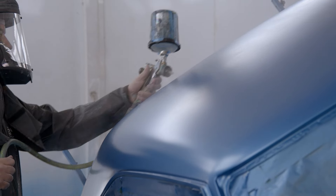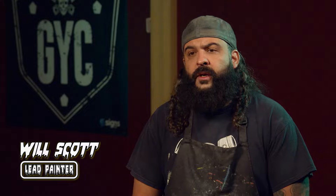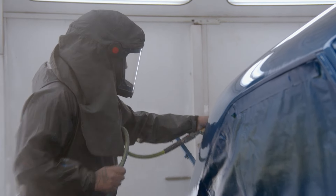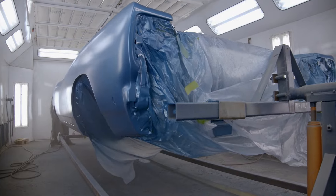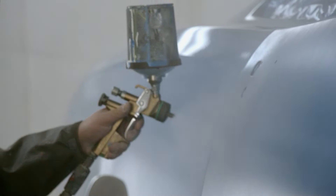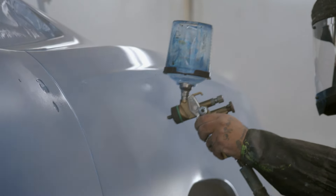When it comes time to clear, I usually don't do it the same day as color — the next day you come in fresh, do a good once-over on the car. We use PPG DCU 2021, a polyurethane clear: very thick, lays down well, cuts and buffs great, holds a great shine. We do three to four coats. There have been times where you'll see a slight wave I missed and I'll put an extra coat of clear on to block it flatter, but for the most part three coats, let it sit for a week or two to cure, then my helper does the cut and buff from start to finish. They look great and then go right to assembly.